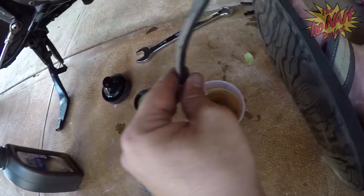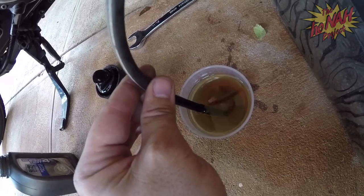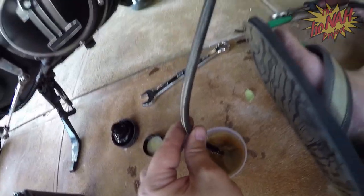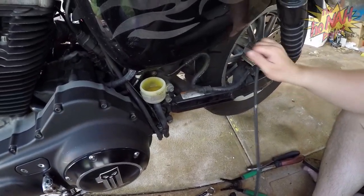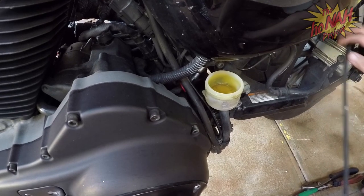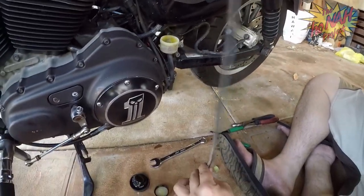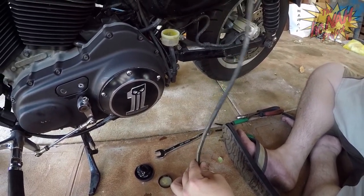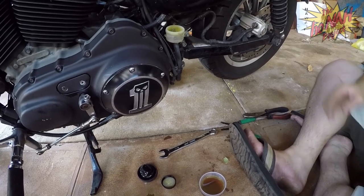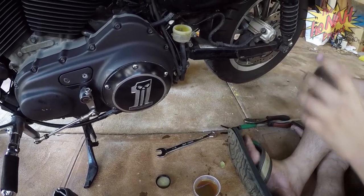What you want to see is your brake fluid become murky because you're pushing all the brake fluid through your system - the old stuff should be flushing out with the new stuff. Now that we've got that done, we're gonna remove the hose and shake out whatever's left in the line just to be safe. We're gonna roll this up, put it to the side, and cover up the nipple.